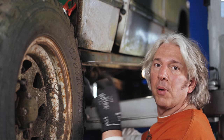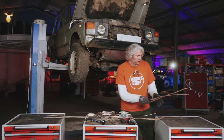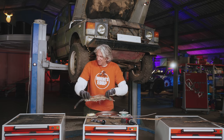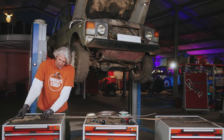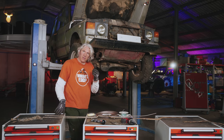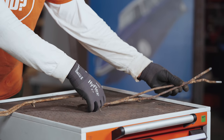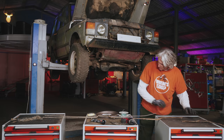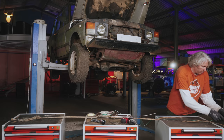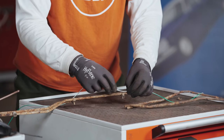The next thing I need to work out is exactly how much fuel line I'm going to need. I'm going to lay out the original fuel lines so I can see exactly how long they were. The only catch is that when I was cutting them to get them out from under the car, I omitted to notice which one goes with which length. They are ever so slightly different, so I'll leave a little bit of extra and that should give me what I need. I'll use a little bit of wire and inch it along to measure — it's a bit easier to handle than a tape measure.